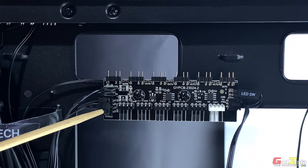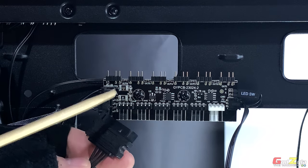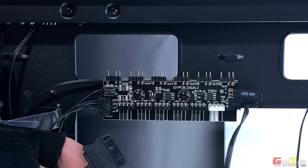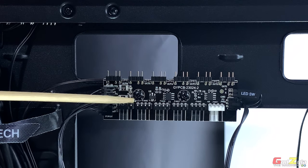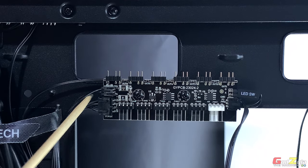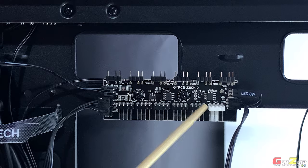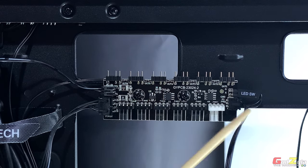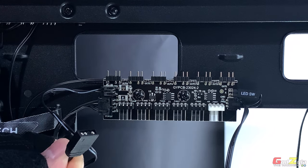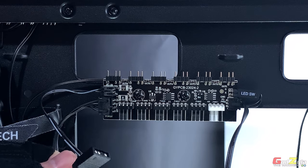Over at this side there are two connection points with cables. The bottom one is a very important SATA power cable — you will need to connect the SATA supply from your PSU to the controller, which then powers all the ARGB components and fans. The ARGB is controlled by the switch at the top. If you choose not to use the controller, you can bypass it by connecting the three-pin 5V ARGB connector directly to your motherboard.